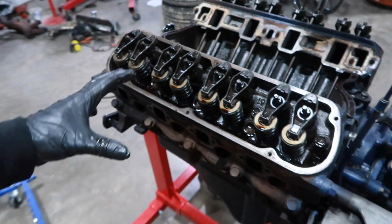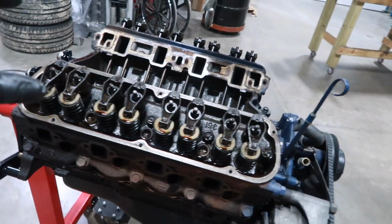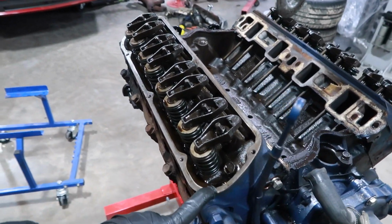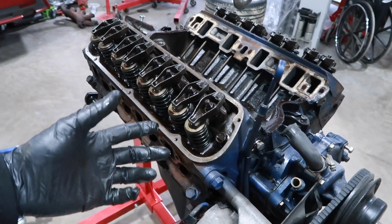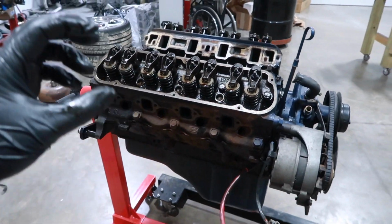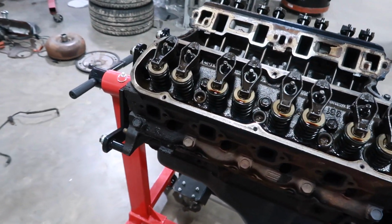This thing is factory AF. This is more factory than the Fairlane motor we did that one time. Or Galaxy motor. Yeah. So I'm hoping, fingers crossed, that we get a set of aluminum heads approved, roller rockers, roller camshaft conversion, tie bar lifters. I mean, you're probably gonna spend $2,000 on that, but not only are you gonna get vast performance increase out of it, but definitely reliability, wear, not have to run zinc oils. I mean, you really get a lot all the way around.